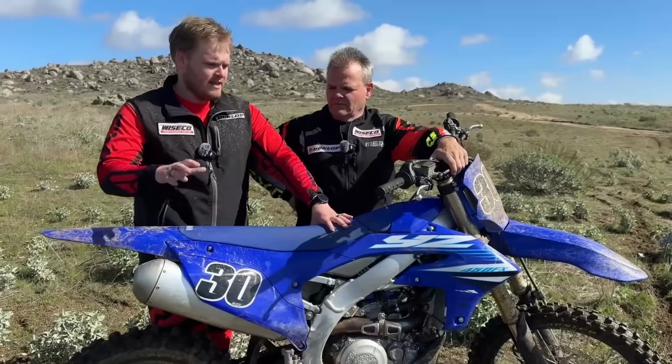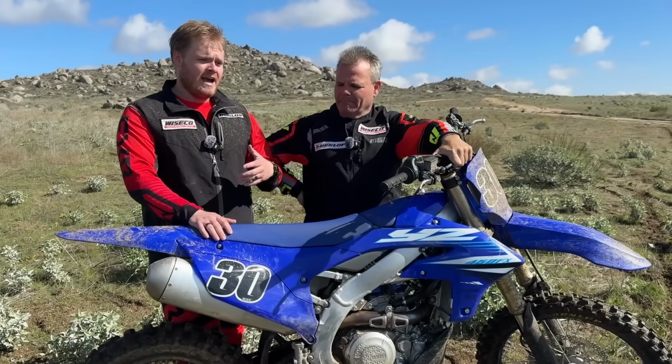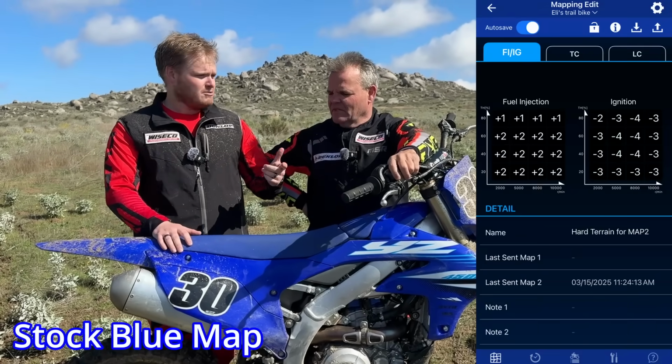I went online, MXA, Kiefer, a couple other websites, and saw what maps work for them. Not many people have published maps for the FX, but a lot of people have F maps. So I would take some F maps from these various outlets and tune them down even a little bit more. I watched a couple of videos, one with Jamie in it, explaining what things do with the throttle position and the rev position. There are videos out there you can watch, and we might do one eventually. But it was cool to see that the blue map that came in stock is more toned down, and that was very good.